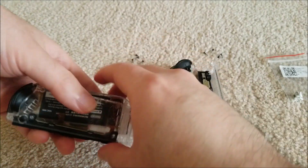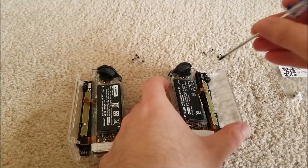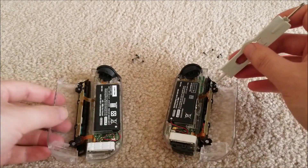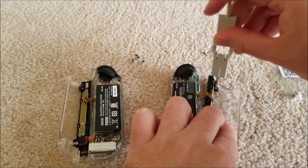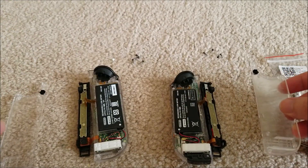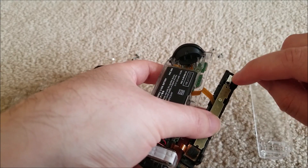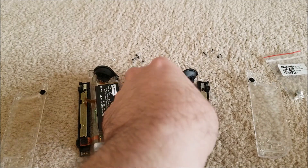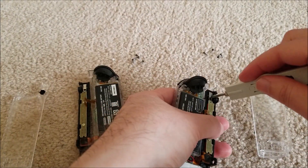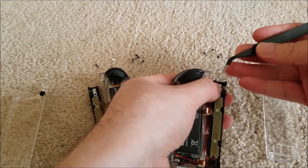Just be gentle with it. We're not going to totally dismantle everything - we only need to get access to this mechanism here. To make that easier, there's a Phillips screw on the top of each one, just one screw and it should open. Now the back of the cases can be completely removed. We need to take apart this mechanism, and there's one Phillips screw on this metal retaining bracket. Tweezers are going to help. One thing to know is there's going to be a little spring there, so you'll want to get your finger over it so it doesn't ping off.